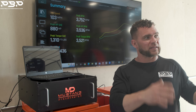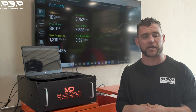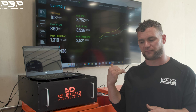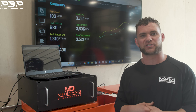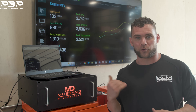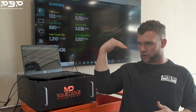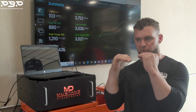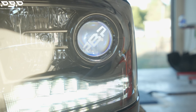We're not going to keep running that same file. We're going to change the timing, add some rail pressure — we've got a lot of smoke. I'm going to swap to a bigger charger; I'll get on the phone with Forced Inductions for a bigger turbine, but I'm staying with an 80. We're going to reflash the truck, start with the Mark 3, max it out, hit that 1,000 rear-wheel horsepower, then swap in the Mark 2 so we can give them an even gauge.